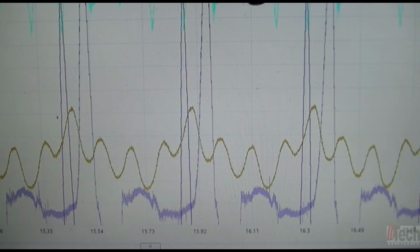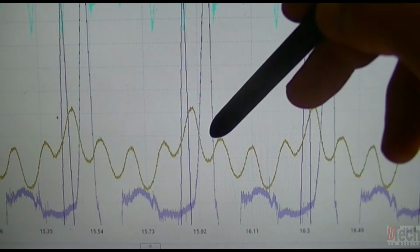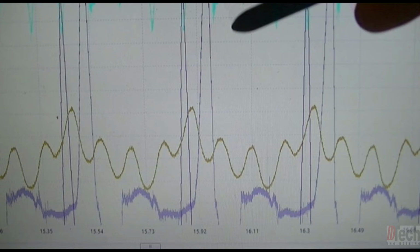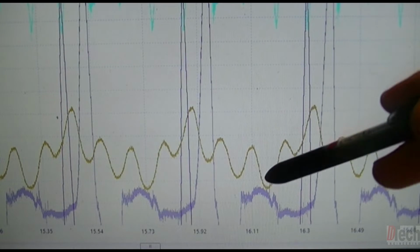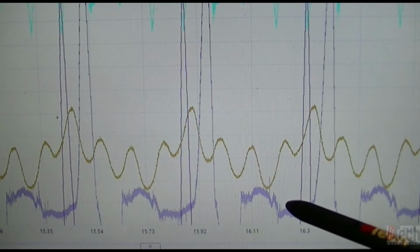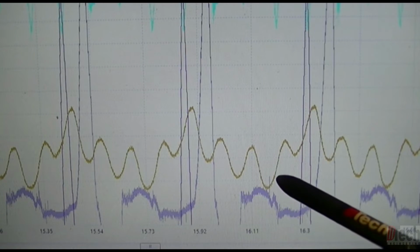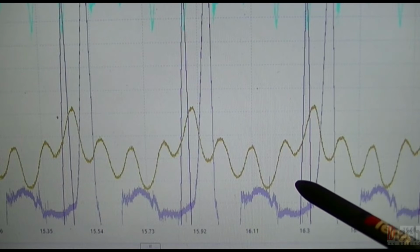Now, yes, in the relative compression there was a dead hole, but it's not a complete dead hole, because obviously we are building some compression, and we know we have a hole in the exhaust valve. So it's able to build some compression, but obviously pressure is lost through that valve, so not all pressure is built correctly. But back to this creation of rise in pressure levels, the other factor that can also cause this is a leak occurring during an intake pull. If the pull is not in a sealed cylinder, then it cannot bring the levels all the way down.